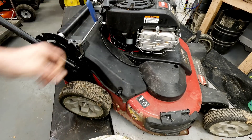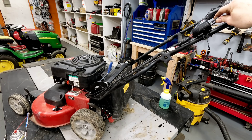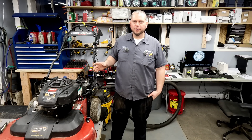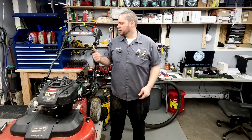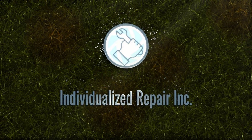I'm going to put our starter back in. Hopefully this has helped somebody out there having issues with their Toro Time Master electric start system. Pretty simple - just a switch, some wiring, a fuse, a starter, and a battery attached to it. It's not a complicated system. Some people get confused by this elaborate switch, but it really doesn't do a whole lot other than make two connections on and off. Thanks for watching, guys. Don't forget to hit that like and subscribe button if you enjoyed the content. And yes, I do know that I need to put the mulch plug back in. We'll see you all next week!